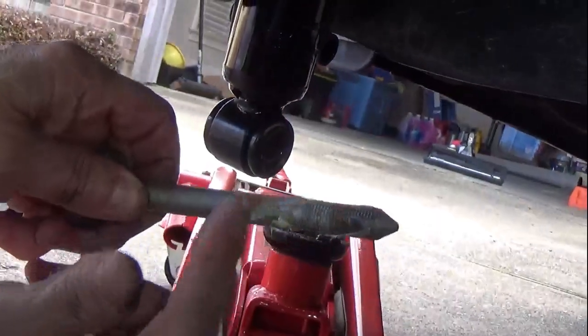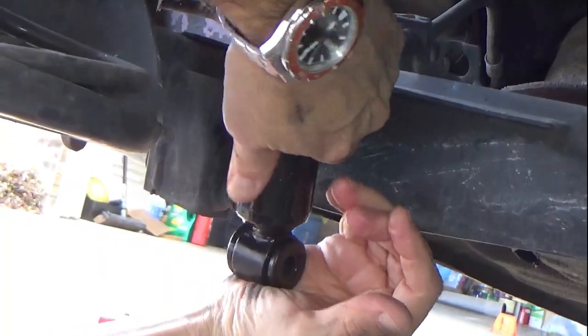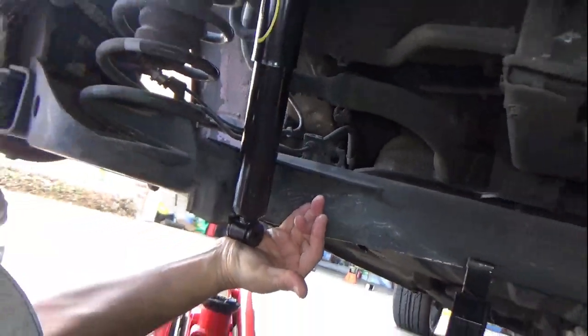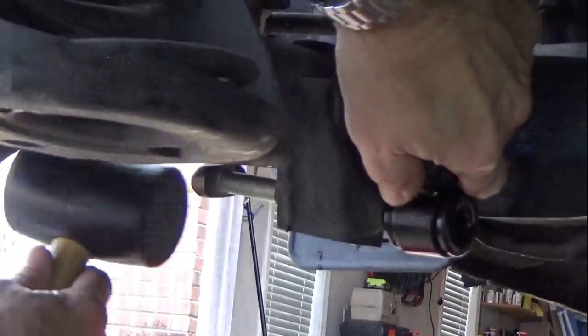To install the bottom bolt, you will need to coat it with grease as well. The new strut will have to be forced to line up with the hole — you can do this by pushing it as shown, or you can use a jack to compress it. It's hard to get perfect alignment, but if you get close enough for the bolt to hold the strut in place, a rubber mallet can be used to gently force the bolt through the strut.